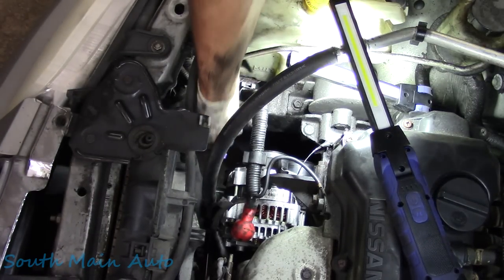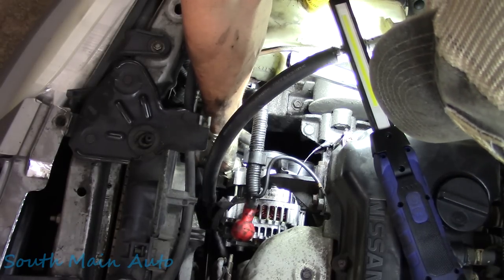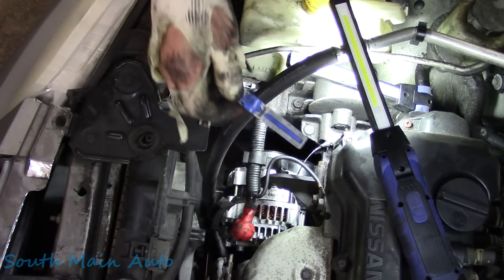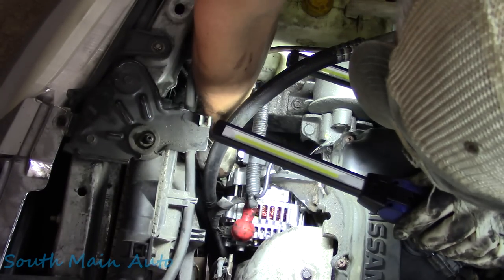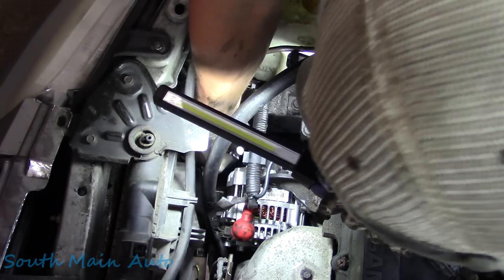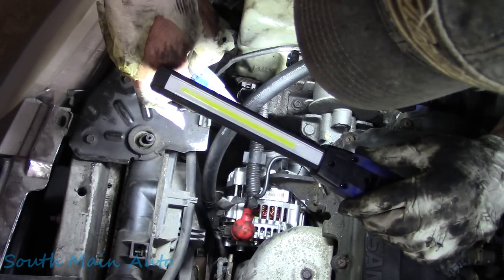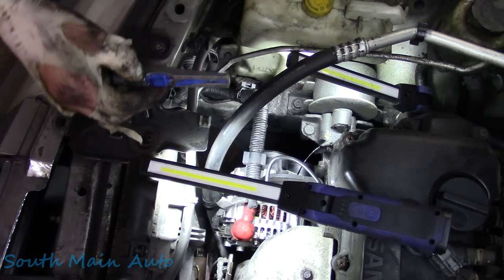So now that that's snug, I'm gonna get down here. We're gonna get after it one more time. Make sure our gauge is all the way down. Let it click, pull her off nice and straight. And we are at, oops, must be I didn't flick it right. It's a little too high. Not high like smoking the reefer high, just too high up on the belt. And there we're at 50, 60, 70 and a half, somewhere between 70 and 80. We're still good. I'm happy.